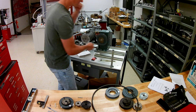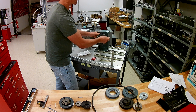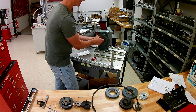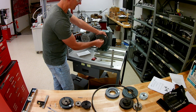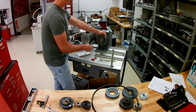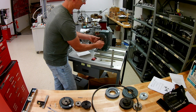How do we get it off? We're going to reverse this process by loosening these things up. I always like to do them in a little bit of a pattern, kind of going around. Sometimes you can even rotate the pulley to make it faster. Once you can remove these things by hand, you're absolutely going to want to do that. So I have the first one free. Now I'm going to move over and find one of the threaded bolt holes. If you look in the threaded bolt hole, there is nothing here — and the whole idea is, as this thread goes down, the end of that thing is going to bottom out on the steel of that pulley. I'm going to go ahead and do it to all of them.